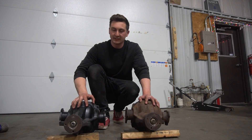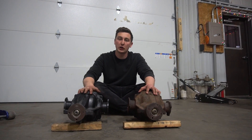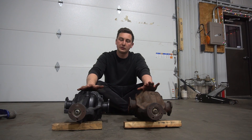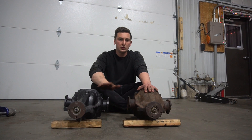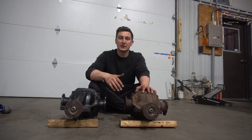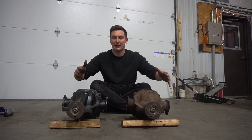With the new diff I have right here, this has a much higher gear ratio than my existing diff. So with this diff having a higher gear ratio, that's going to basically shorten my transmission gear — we're going to be trading top speed for quickness, essentially. So now this should allow me to drift in third gear without any issues. The problem with the stock diff is it makes my gears too long. With a four-cylinder, most of my power is up top, so if I shift into a higher gear and my RPMs are low, it's just not going to happen. With this, it'll put my RPMs up higher in different gears at the same speed, allowing me to have more power to drift in that gear.